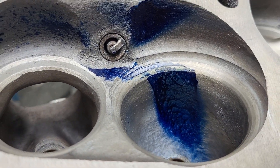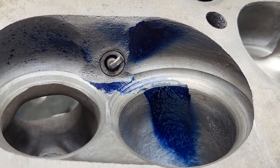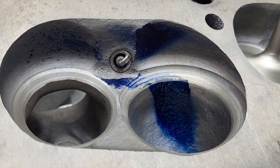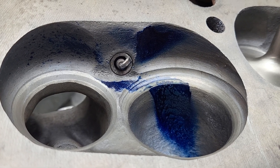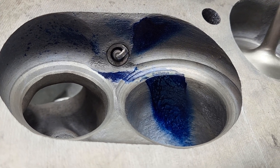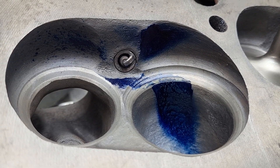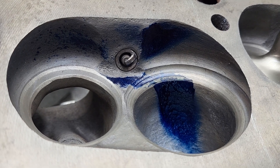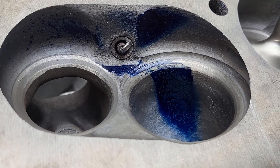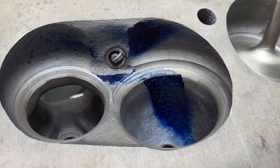I think I was toying with putting an even bigger valve in these. The reason I've been saving these is supposedly this is a valuable set of heads. I know they came on the 427 435-horsepower Corvette engine. They had the smaller exhaust valve — I'd say around 1.70-something exhaust valve. They were closed-chambered rectangular ports and they made some decent power.